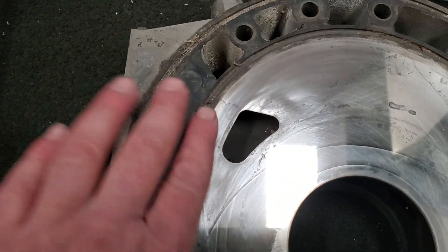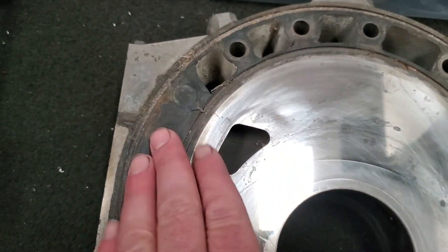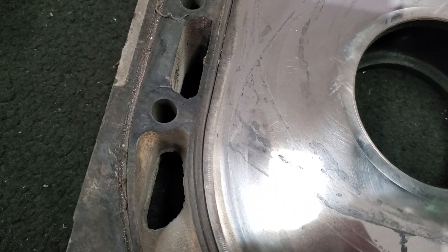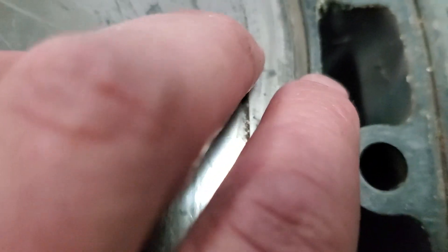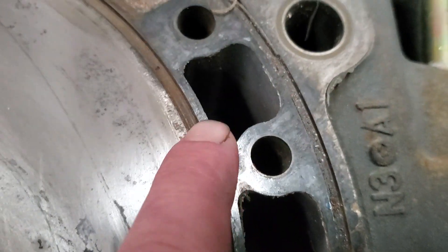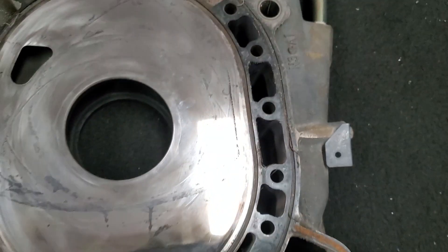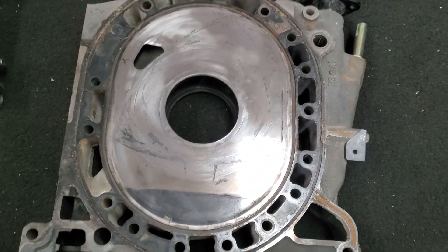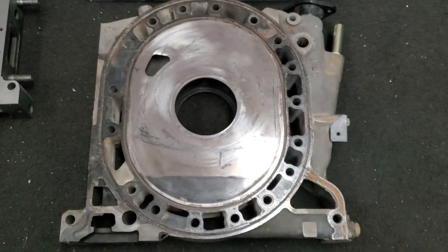Also leading into what would be the rotary's head gasket area — your water seal area. If any of these grooves have damage, which some of them do right in here, anything over a couple thousandths can cause premature water seal failure, or if the groove itself is misshapen, that can be a sign of potential failure to come.